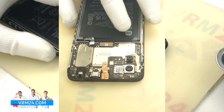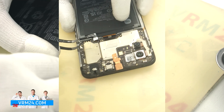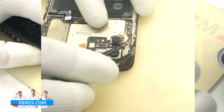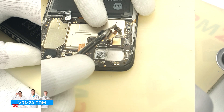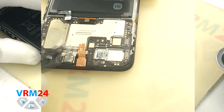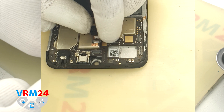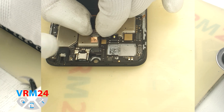On the back side we see the hole for the microphone. We can disconnect the display connector and the coaxial cable connector. Then we disconnect the connectors and take out the two rear cameras. They are slightly glued with a copper heat sink film to the motherboard shield, so it is best to peel the film off carefully to reuse it.